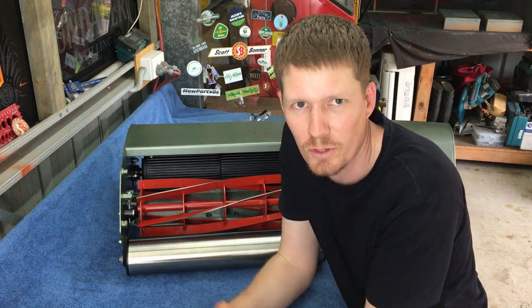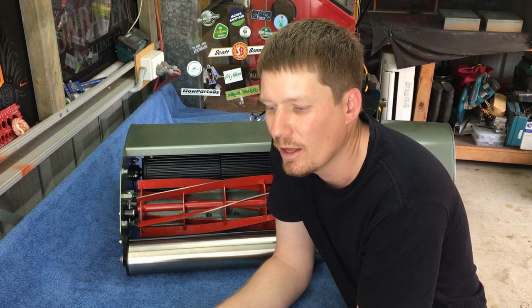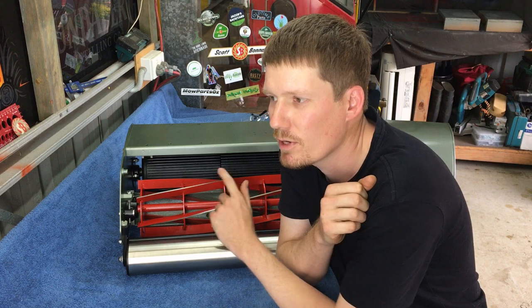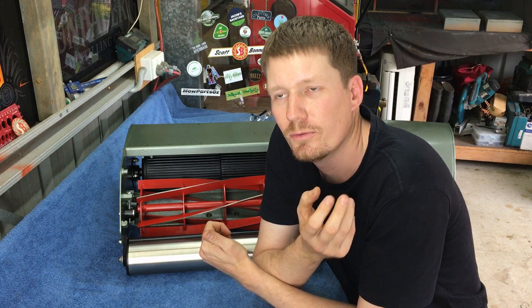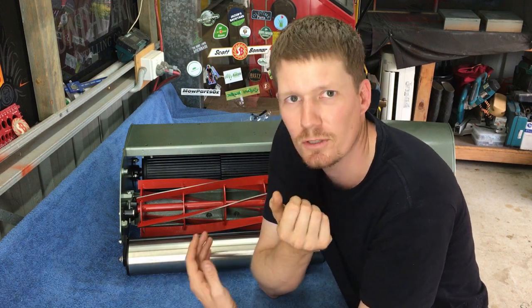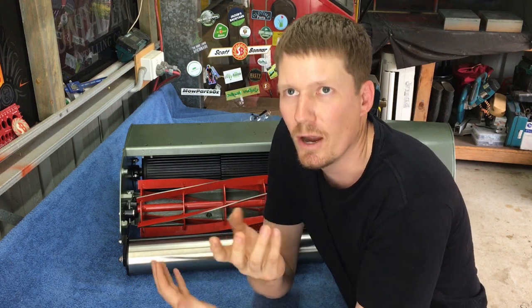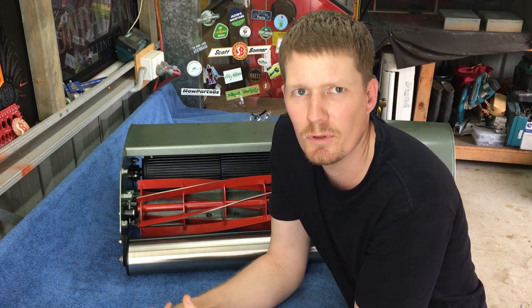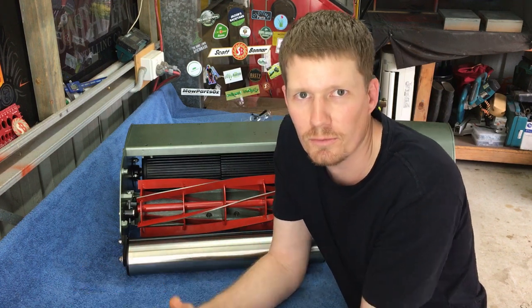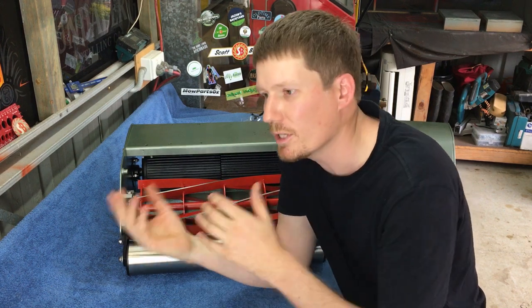Now, I'm only talking minimal amounts of contact. I'm not talking heaps of contact. I personally believe if you're a paying customer, that the business should adjust the reel so it's making contact with the bed knife. One, for the longevity of the adjustment. If you've paid for something, you want it to last longer than someone that's doing their own work and can adjust it regularly. Generally, if you're paying someone to do it, you probably don't have the mechanical mind or skills to do it yourself. So you don't want to have to take it back in a month's time and get it readjusted.